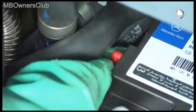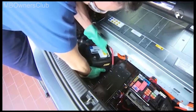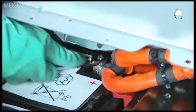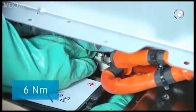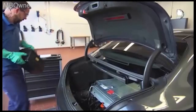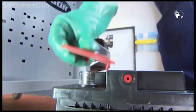Unclip the positive cable that runs along the body. Then disconnect the breather hose. Now you can turn the battery so that you can get access to the positive pole. Take off the cap and remove the positive cable — tighten on replacement with 6 Nm of torque. Then take the battery carefully out of the trunk. Protect the positive pole again with a cover and the removal is complete.